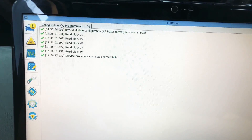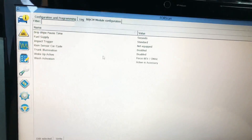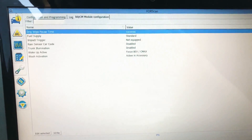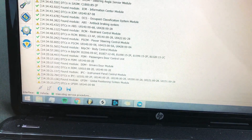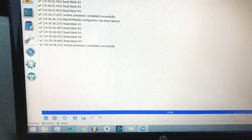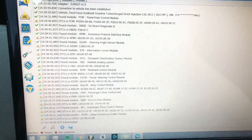So go back up to configuration and programming. You can click on 'Body Control Module and Configuration' — that should work, right? But it doesn't give you any sort of programming ability. So this is how I got it to work. Make sure you hit stop whenever you leave the configuration and programming section — just hit stop so nothing gets messed up. Then come over here and disconnect from my BCM and ECU.